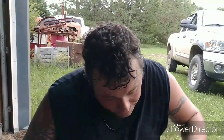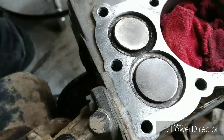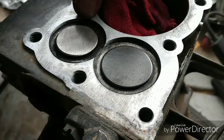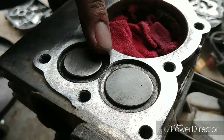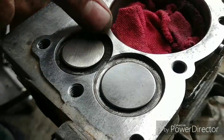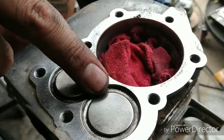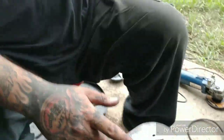As far as some real simple performance upgrades, nothing huge — old school flathead technology. We're gonna shave the eyebrows off. We're gonna take our Dremel and start shaving away the material here between the valves, and what that's going to do is help the airflow into the cylinder smoother rather than having to ramp over the top. Old school flathead technology — we used to refer to that as shaving the eyebrows off. So that's the first thing we're gonna do.